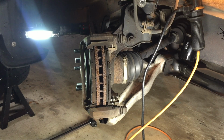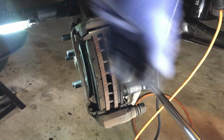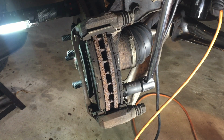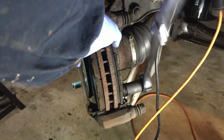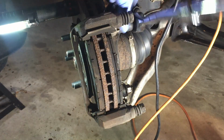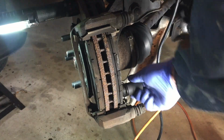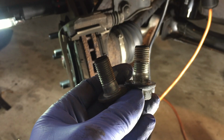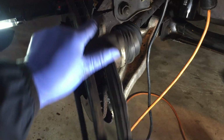It's easier to use an impact wrench for this kind of removal, but I want to show you how to do it with a hand tool. Hopefully, we'll succeed. Back with the breaker bar. Sounds like it broke loose. It works. Continue with the ratchet. After we take off the two 19 millimeter bolts, we will be able to remove the bracket.